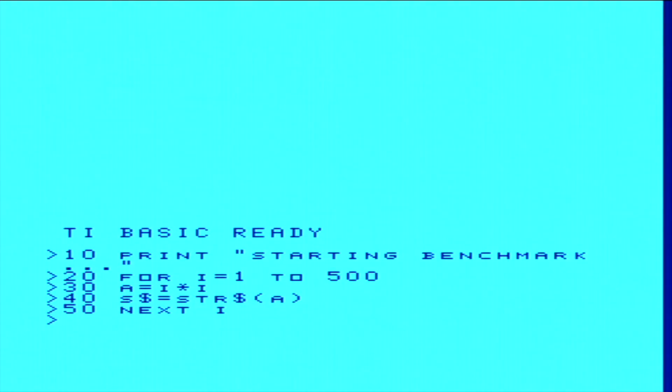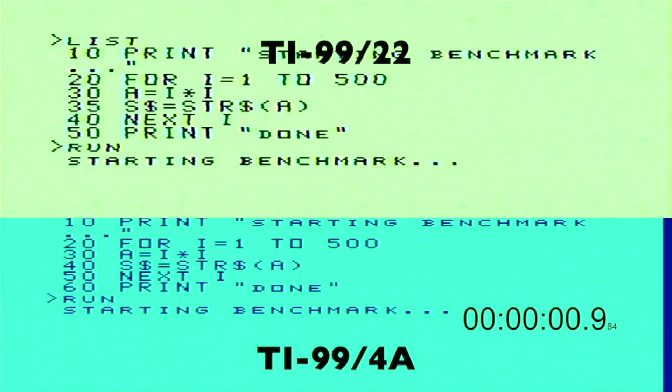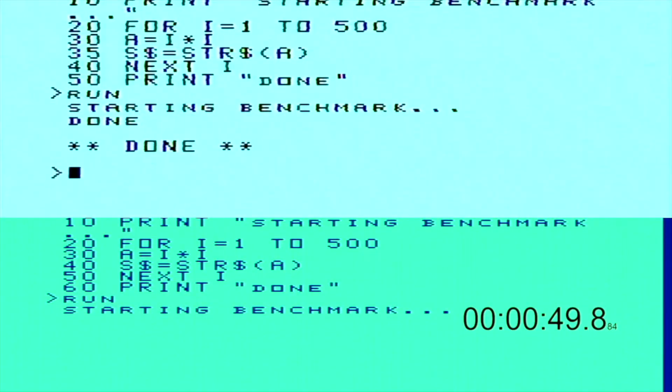Let's take this one step further. How does this modern remake perform against the TI-99 4A? I've set up both systems running the same short TI BASIC benchmark — nothing fancy, just a loop doing some maths and string operations. It's simple but a good way to compare execution speed. The TI-9922 isn't dramatically faster; BASIC still runs under the same interpreted model as it's written in GPL. But it's rock solid. The video output is cleaner and it boots faster thanks to the modern GROM emulation. It's less about speed really, and more about reliability.